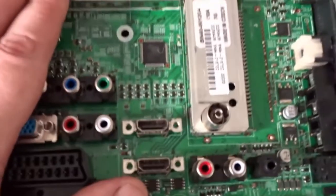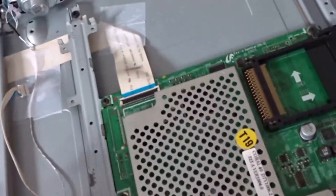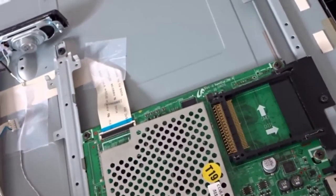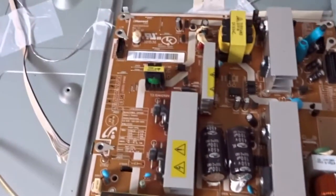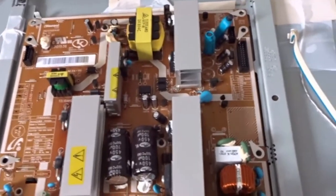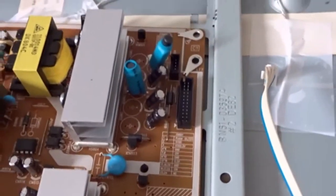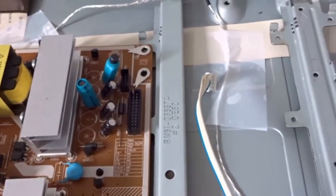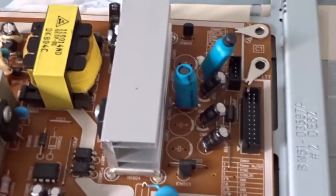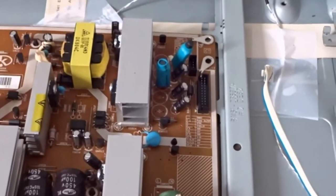The television inside is immaculate — there's not a mark on it anywhere, it's been really well looked after. But it's just one of those sets that has fallen victim of the capacitor plague affecting televisions from the 2008-2009 period and 2007 as well. I think this is a late 2008 model. I've confirmed it's got a brilliant picture by running the hairdryer over the caps. Don't leave it running for long periods though — the amount of ripple those damaged caps give off could damage the rest of the set. Just do it for testing purposes to make sure the set powers on.